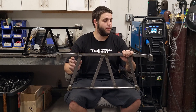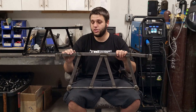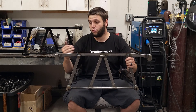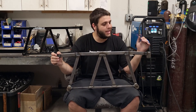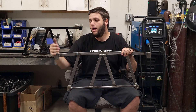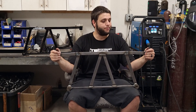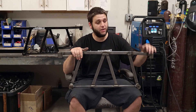The entire piece is constructed of tube steel. It's a very thin-gauge tube steel that's used on its edge. This allows the product to be extremely light, as well as very strong and rugged. A lot of the aluminum braces I've seen from competitors tend to end up with the cups being deformed after some road debris hits it, which makes the brace completely having to be ground off the car with a grinder — it obviously destroys the product in the process. The steel I use prevents that from ever happening.